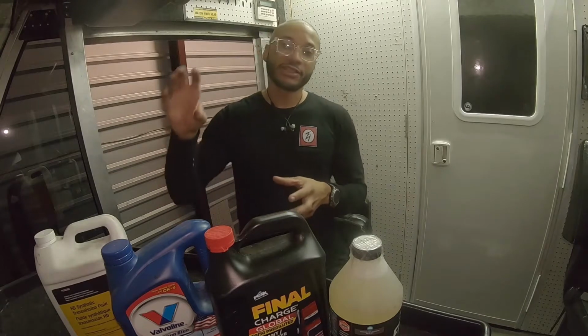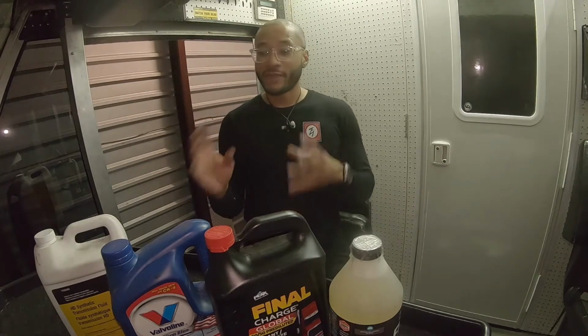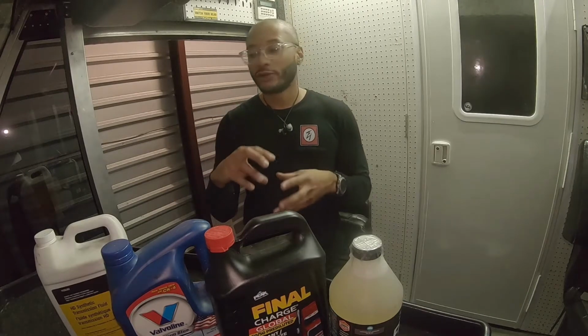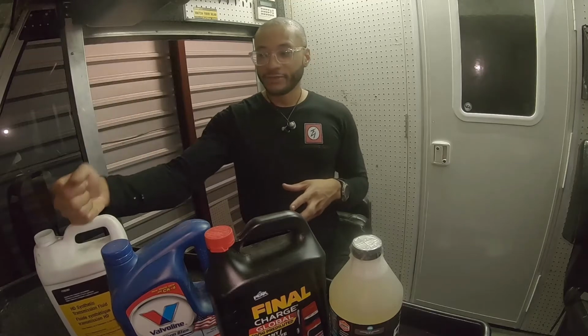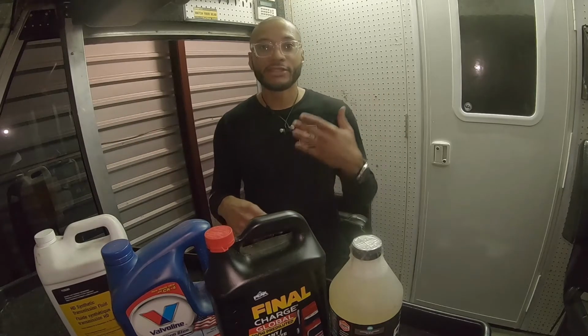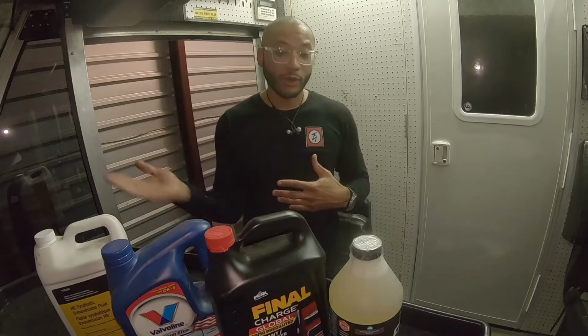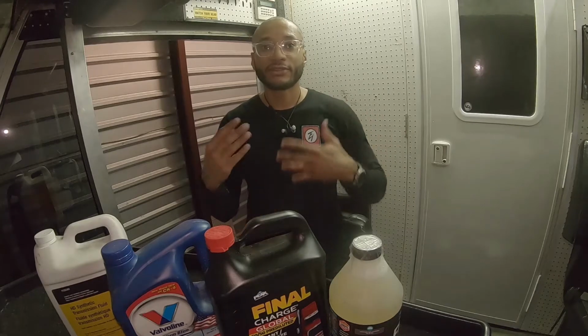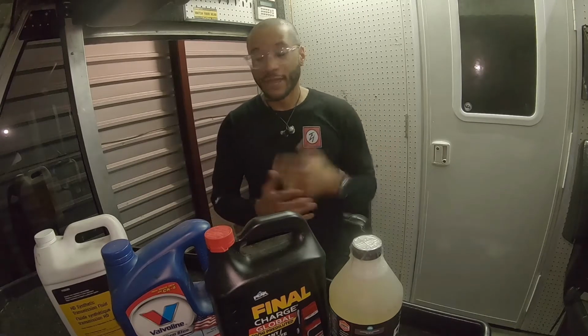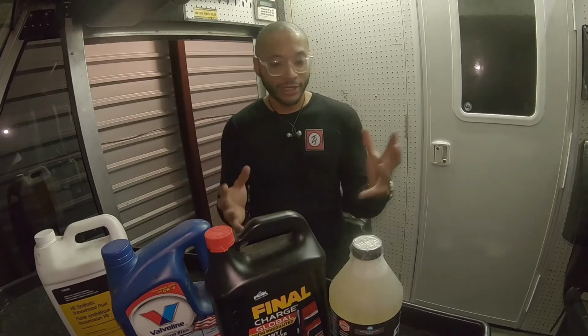Priming your oil filter is adding oil inside of your filter before you put it on, but just make sure you don't get any debris inside that filter, because that's going to be unfiltered oil. And with the transmission, you fill, and then you want to run it, get up to temp and just keep an eye, keep checking in. The same thing with all the fluids. As you go, check it the few days after as you drive and you stop, just make sure everything is topped off, because the temperature does play a part in your fluid levels.